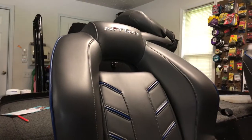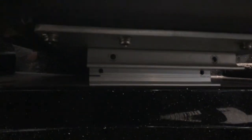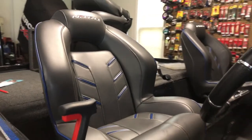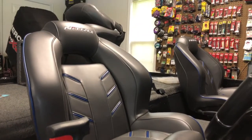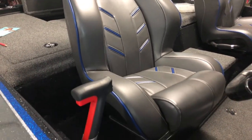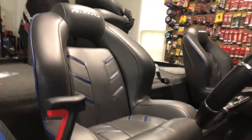First things first, get down to the front of the seat — you've got two screw holes right here. I've already got one out, but that's all you have to do: take those two hexagon screws and unscrew them. Once those two screws are out, all you've got to do is slide the seat off to the side and it'll come right up. And the seat's out.